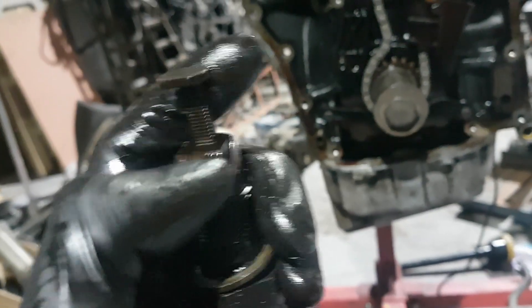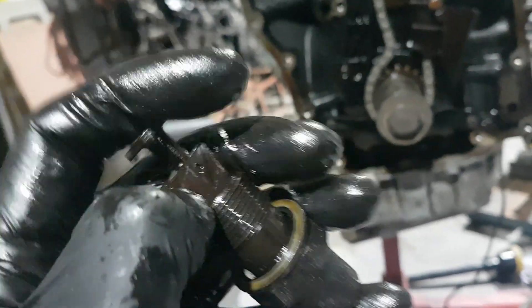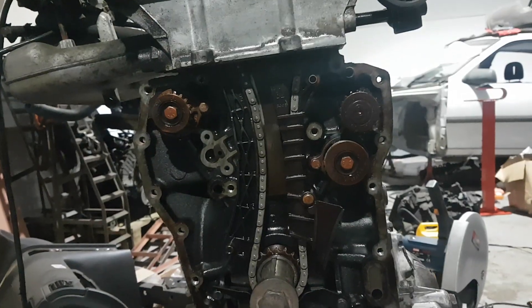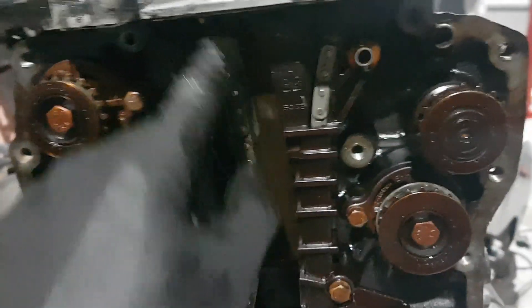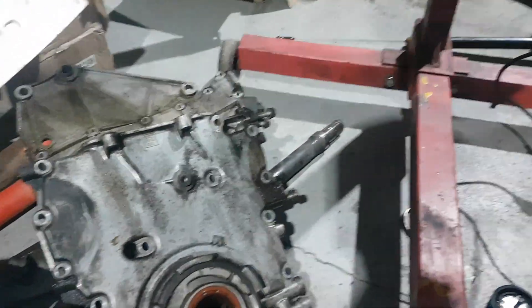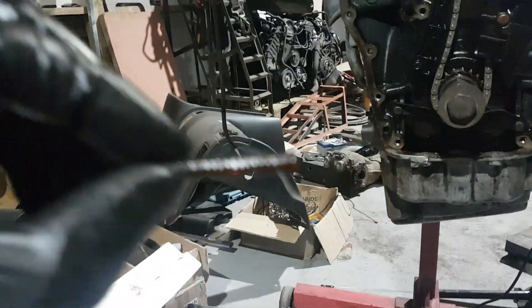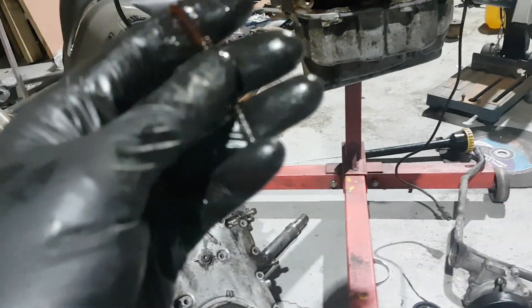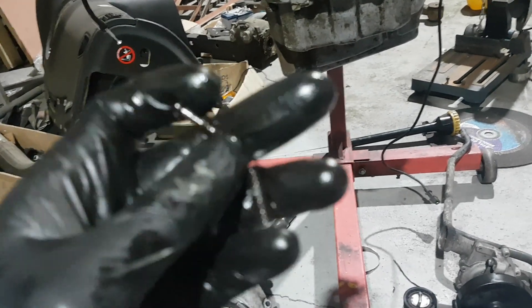To reset the tensioner, push that in with a little pin. There we go, that's reset now. Make sure you've got a nice new washer on there. Now I've fitted that in. What you'll notice is the slack has gone from here but not quite from here, and this is where the spring that inserts into the tensioner comes into play. Inside there is actually a nylon plastic guide in the middle — make sure that's not broken.